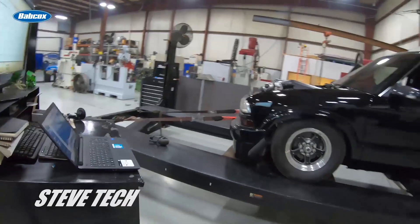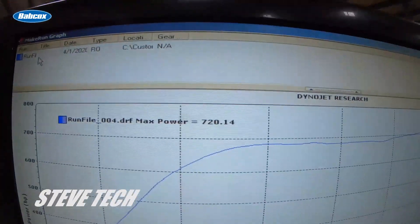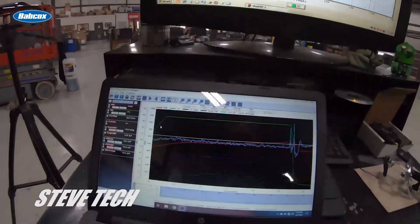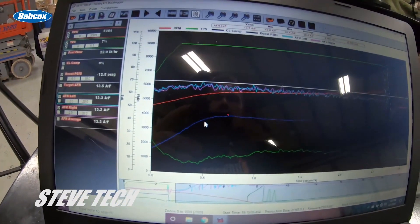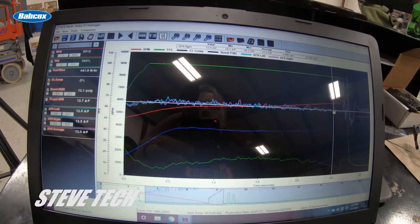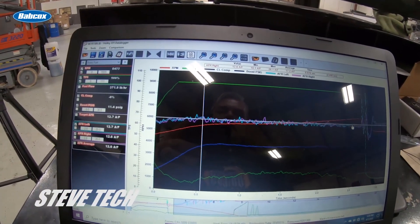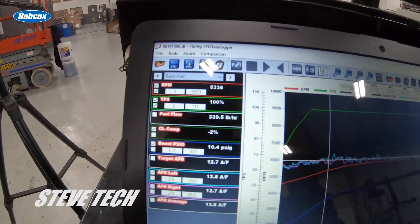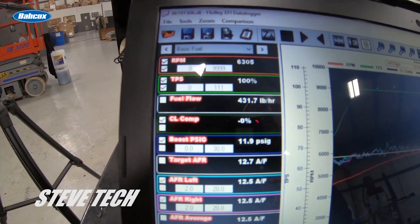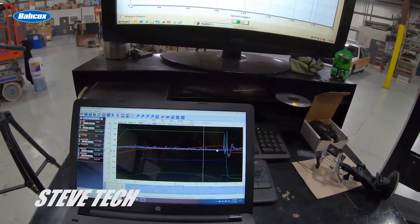We just made that pull and you can hear it was a little bit longer. We made 720 — pretty broad and flat. Boost comes right up and then just lays over right through there, and you can see that on the graph too. The boost line just flattens out because it's hitting the wastegate, which is good. We're doing a real nice job of meeting our target AFR and everything looks good — minimal correction, we're at one, one, one, one percent.